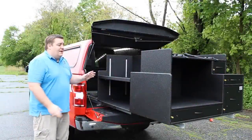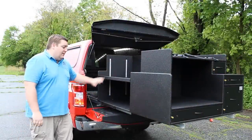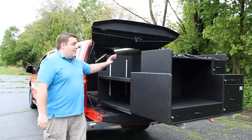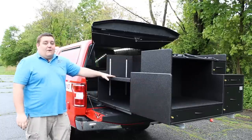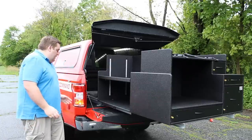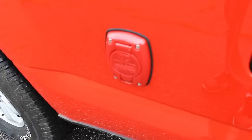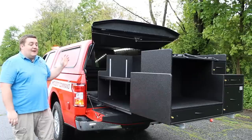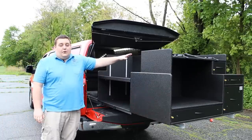On the driver's side of the cabinet, we have an adjustable shelf that can be moved to any position by loosening a couple of bolts, with a power strip mounted to it. This is tied into the inverter with a built-in transfer switch. Anytime you plug into the shoreline, it energizes the power strip and charges the battery. Anytime you turn the inverter on, this will also have power.